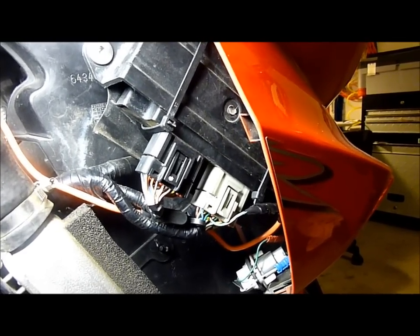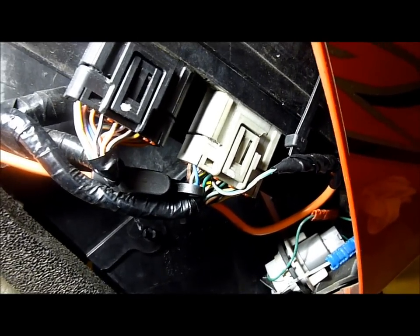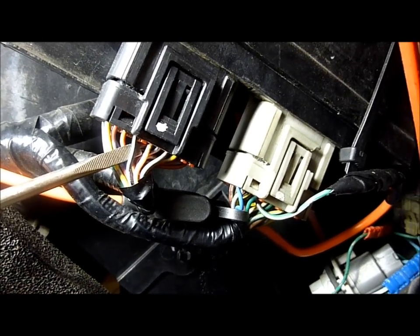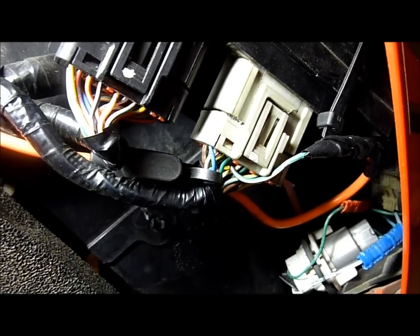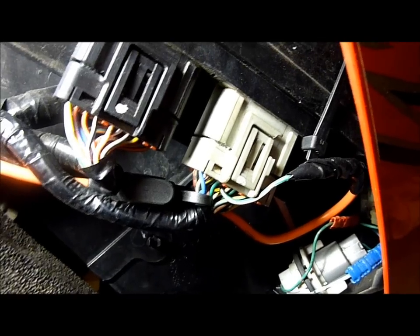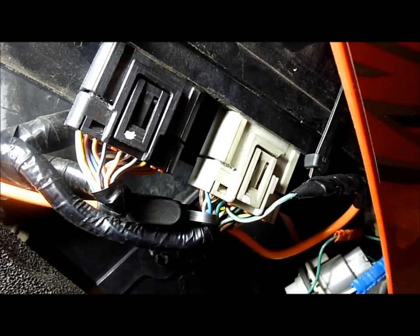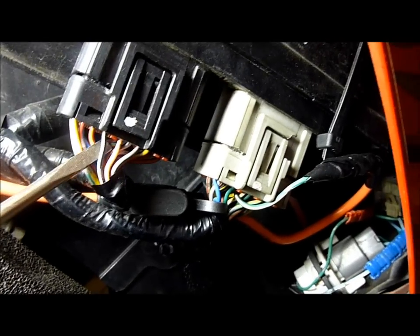The fuel pump won't prime. Well, there is only one difference, my friends, between American ECUs and Australian or European ECUs. Australian and Euro ECUs only have one 12-volt power feed, which is the black and white wire. American ECUs have two power feeds. If you don't feed that second power pin, the ECU will not boot up. This is probably a security feature.